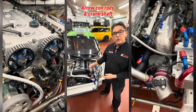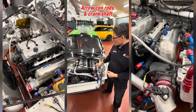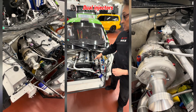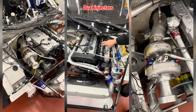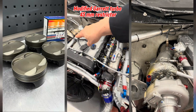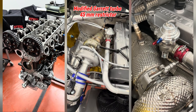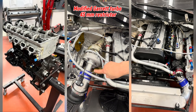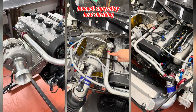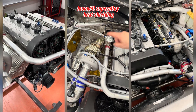On the crown of the pistons they are hard anodized with a PTFE Teflon-like coating which also reduces friction and is less abrasive. We also installed Diamond heavy-duty wrist pins with a DLC — diamond-like carbon — plating, which makes them very strong and rigid so they don't bend and can take a lot of RPMs. In addition to that, we have installed Arrow con rods and crank in the engine. This specific engine also has dual injectors per cylinder, so eight injectors in total.